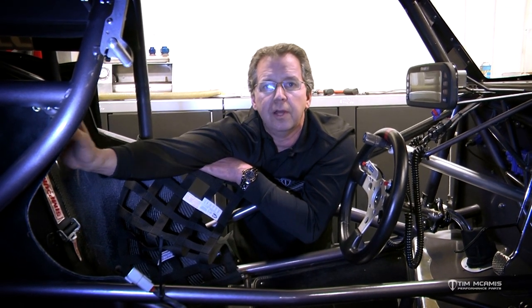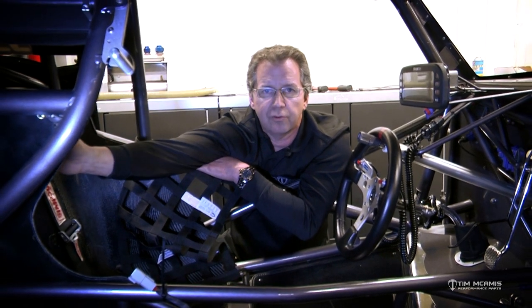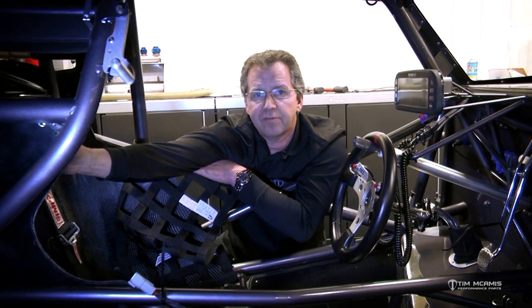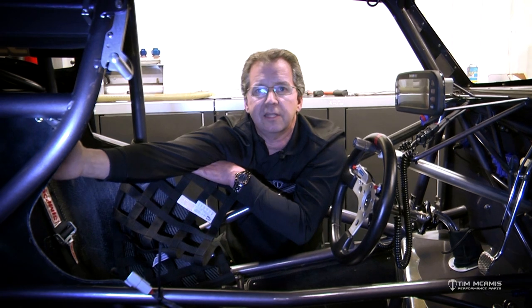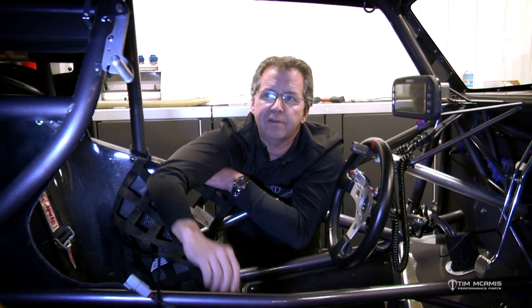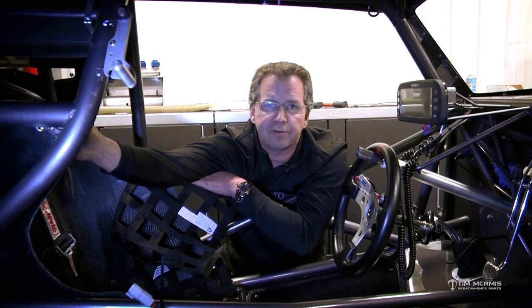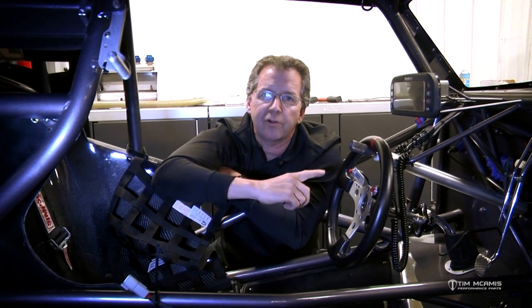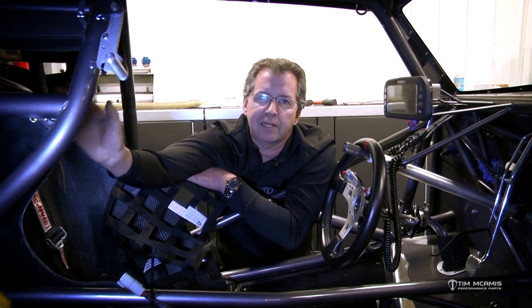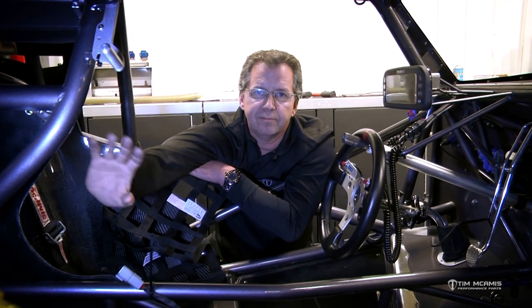These bottles were still full, but they had lost their pressure. This car was built about 12 years ago, and the bottles have probably been in there since and never been inspected. Over time, the seals probably leaked and they lost their pressure — they still had content, but no pressure means the content doesn't come out when it's time to use it. You have to check this stuff. Make sure the handle is accessible, the cables are lubed, and you have pressure in your bottles. It takes five minutes to look at the fire bottle system. Seriously, take some advice and make sure it is in good working order.